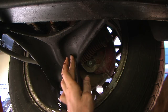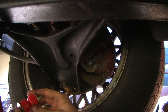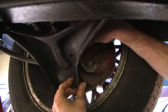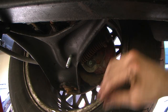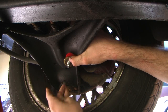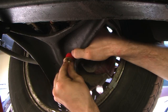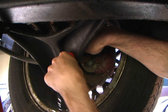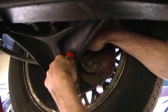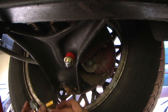This is the hole we're going to use. We're going to take the urethane bushings apart. We're going to start from the back side and slide it through. Take our nut. We're going to take a wrench and tighten it down to the point that everything's snug — not crushing the bushings, but snug them up — and then we're going to add the next piece.